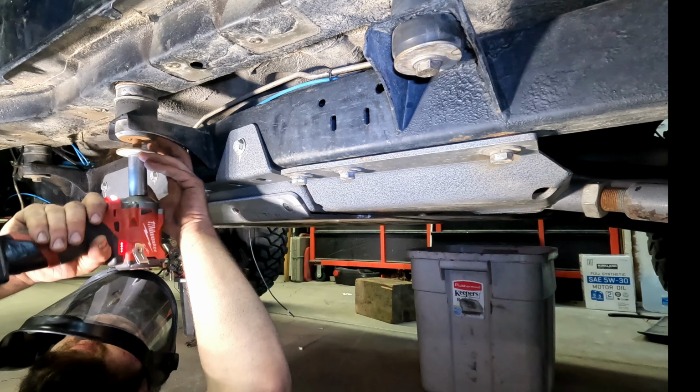The Spectre body mounts are extremely thin. They get hung up on rocks. They get dented very easy. So we decided to replace them with the TNT 3/16 extreme body mount. This here will actually raise the body mount up higher to give you a little lift. My Jeep already has a little lift on it to clear the automatic and the transfer case.